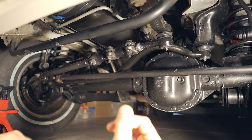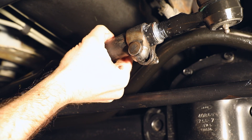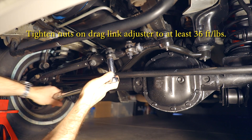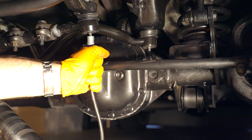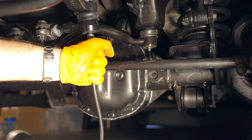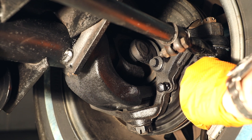Now back the Jeep up, roll it forward, and check the steering to make sure it's centered. Loosen the drag link adjuster bolts and turn until the steering wheel is centered. Have your partner tell you when the steering wheel is centered. Once it is, tighten the nuts on the drag link adjuster to at least 36 foot-pounds. Don't forget to grease the new rod end joints that we installed — pump grease until the rubber boot is full, but don't pop it so don't go too far. See the clean grease coming out from around the edges? That's the perfect amount. When you're done, you'll still need to have a full proper alignment done, but for now this should get you by.